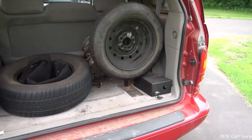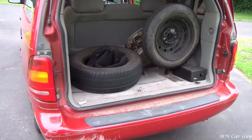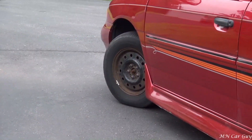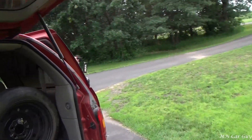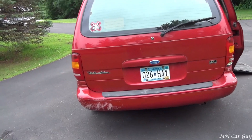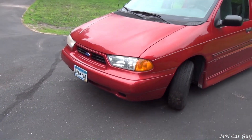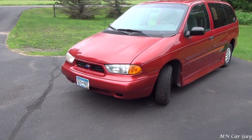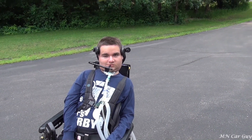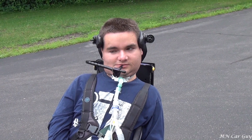There's the cargo area. We did find some hubcaps for it — we've got three out of four, so the one up there is missing. We've sourced those from a guy we know locally and we'll just replace them. One thing we've already noticed is this hatchback does not like to shut all the way, so you've got to slam it. We already had the battery go dead once because of that issue. Also, going down the road it doesn't go straight, and at about 60 miles an hour it likes to shudder — it gets worse when braking. We also get a clicking when turning and accelerating, so that's most likely a CV joint that needs to be replaced.